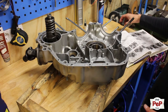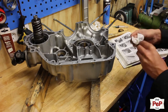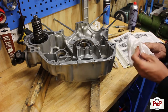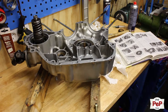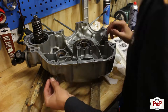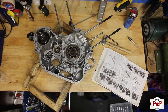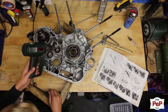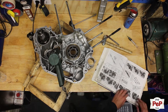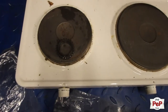I was mentally preparing when and how I would install it this time. Since I reserved this evening for engine assembly but couldn't continue due to the crankshaft being in the freezer, I decided to prepare everything I already could do — for instance installing the neutral switch together with new seals. I have all types of copper seals and rubber seals and never re-use the old ones. The next day, important is that you really heat up the surface where the bearing or items will be installed. For this I use a heat gun, but you can also lay your engine half on an electric stove for instance.